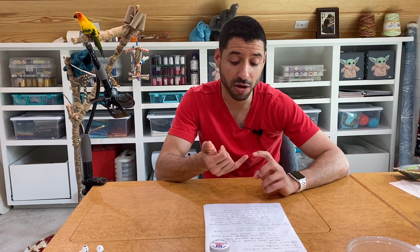The next common issue is error message 1010. It can happen when you turn on the machine, after you rethread it, or when you first start to sew. The error 1010 means your bobbin case is inside the hook system and that mechanism can't turn or spin. Basically it means the hook can't move — something is blocking it. It could be the bobbin in wrong, the bobbin case in wrong, the hook positioned incorrectly, or a piece of thread or needle behind that metal magnetic hook.